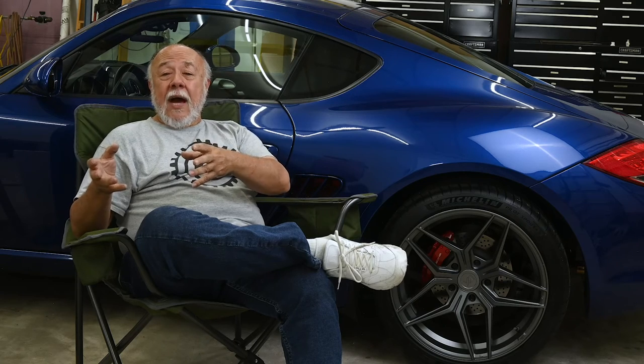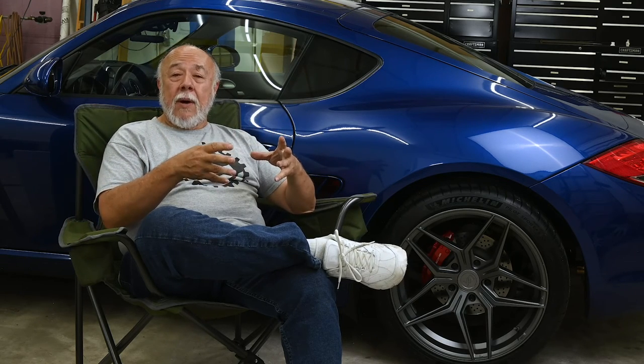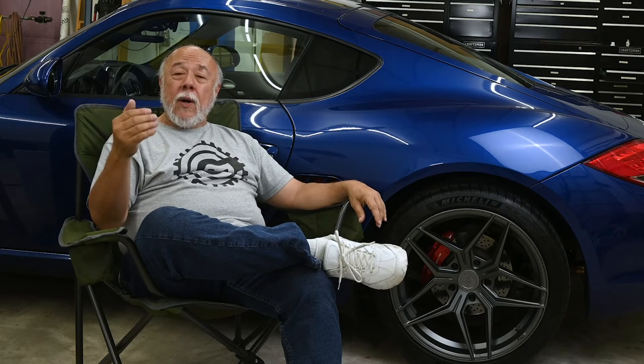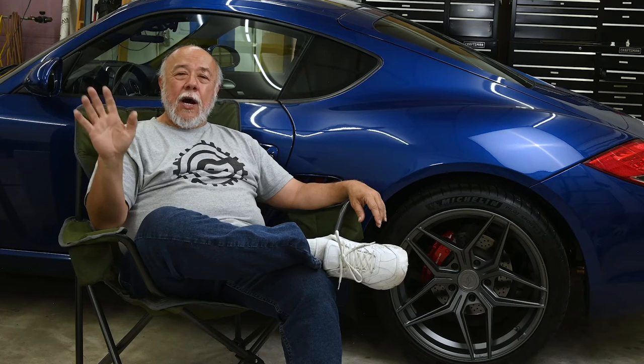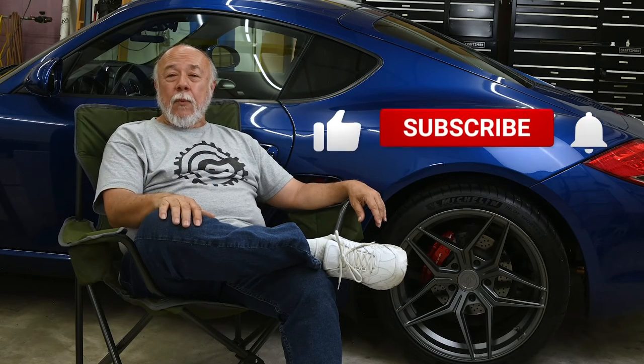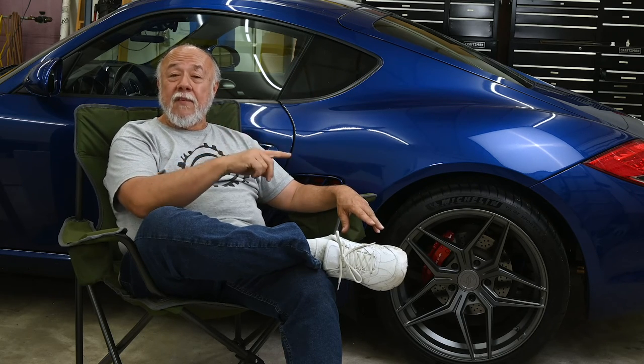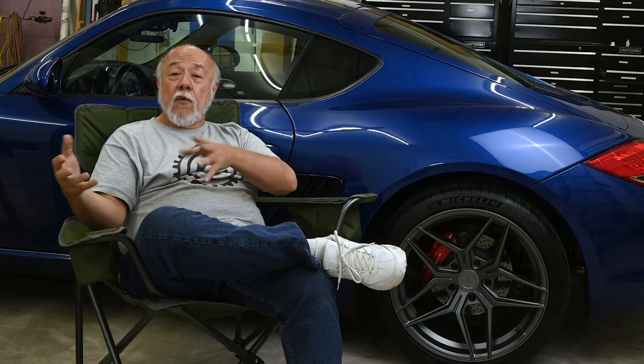Now, the other thing that I basically screwed up on in building my initial mathematical model to compute horsepower gains was that I discounted the effect of relative humidity and barometric pressure. What I found in doing more research was that they have a far bigger effect on engine power than I had assumed. So a couple things. One, I went back and rebuilt my mathematical model to allow relative humidity and barometric pressure to be input into the model. I also went back and, luckily, I've got barometric pressure and relative humidity data in addition to temperature for the days that I did testing previously, and redid my computations for the Carnewal exhaust.